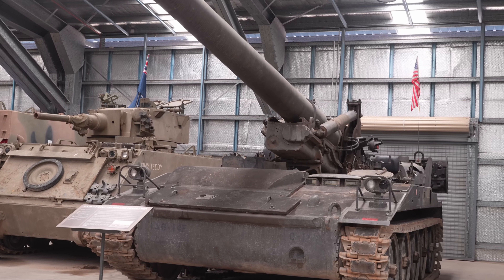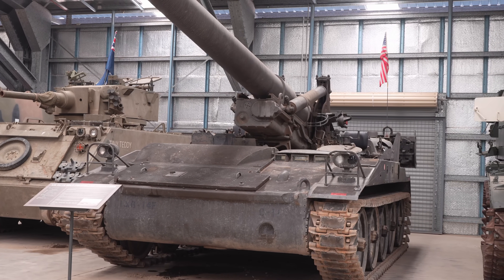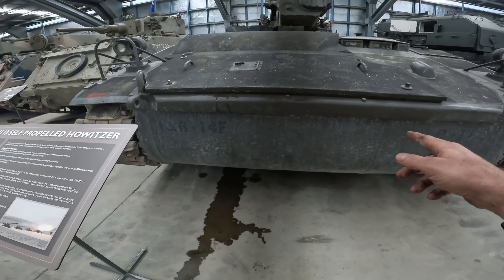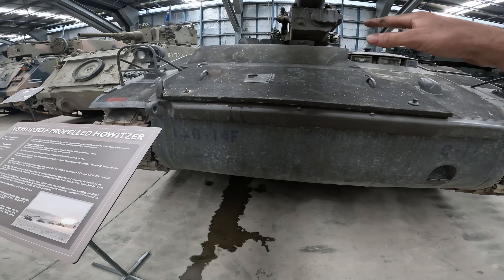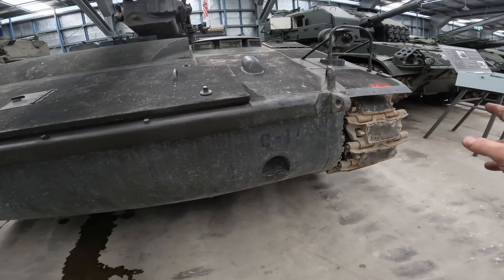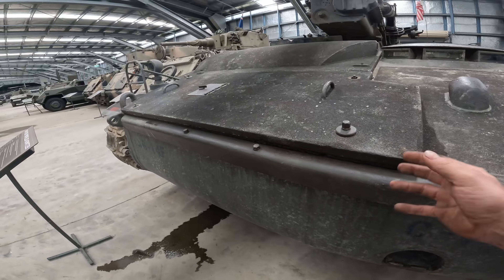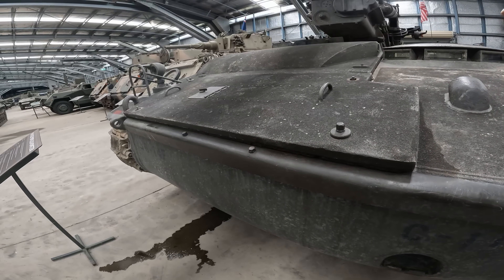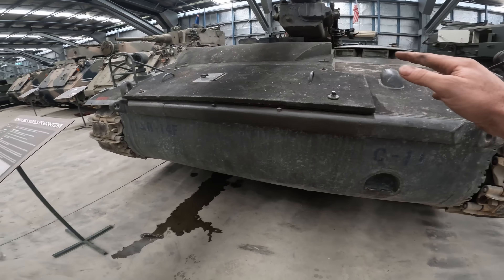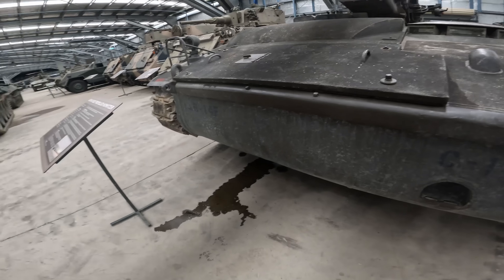The 110 has sprung some sort of engine oil leak, and it's also got an ongoing issue where diesel is getting into the engine lubricating system. We really need to fix that because the diesel just overfills the engine oil and destroys its lubricating properties, which can be accelerating wear on the engine.